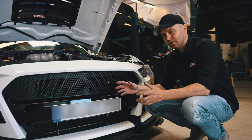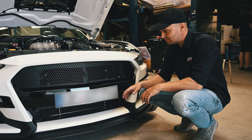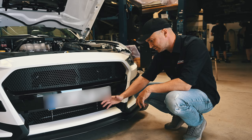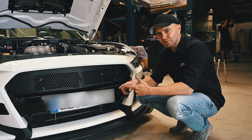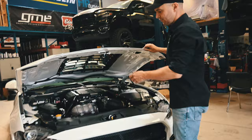If the oil cooler were in front, the hot air from it would blow over the intercooler from the supercharger, then over the water cooler and air conditioning cooler. Instead, we chose to put the oil cooler in a horizontal orientation, laying flat behind the air intake in the front bumper, so the air exits to the bottom of the car. This means the intercooler also gets direct cool air. This cooling concept results in cool air temperatures for the supercharger and cool oil temps for the engine. The remaining air exits through the hood, which is a great feature for high speeds and good handling.